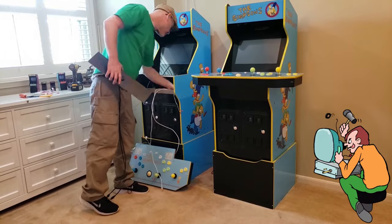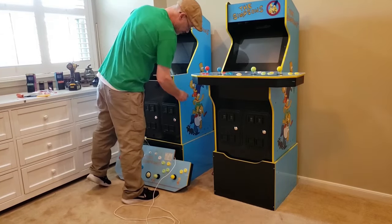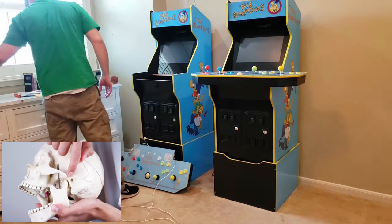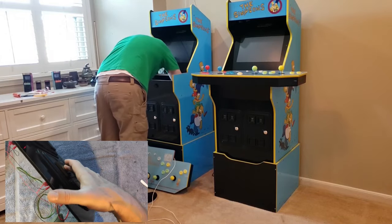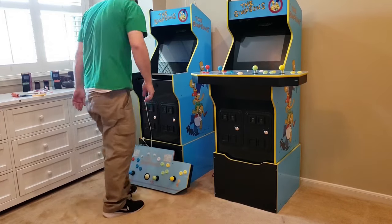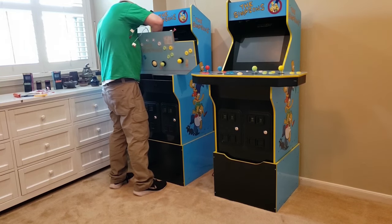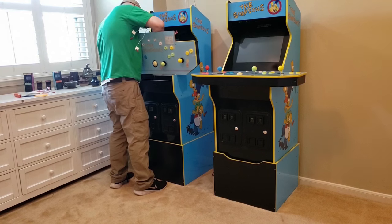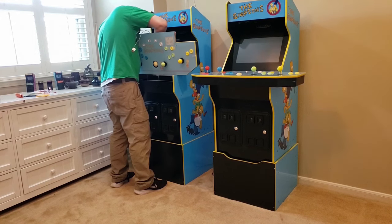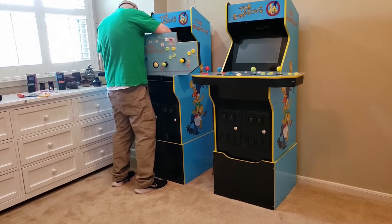As I said earlier, I wasn't so worried about getting everything apart, but putting it all together is a different story. The screws and plastic mounting caps are very small and are giving me a little trouble. However, with persistence and holding my jaw just right, I'm able to get each screw started, checking the insert and button alignments now and again and making the needed adjustments along the way. After getting all of the screws and plastic mounting caps secured and getting the coin insert and buttons aligned, we'll need to get the wiring harness connected to each of the buttons. Our wiring harness is what carries a signal from the pressed coin button to the control deck, so if we don't reconnect them, the buttons will not work.